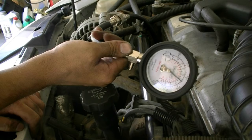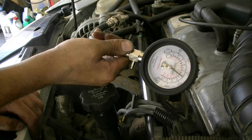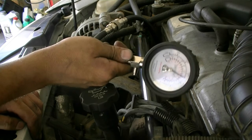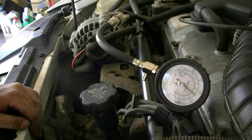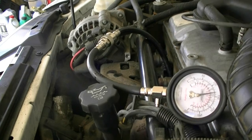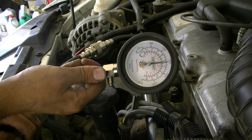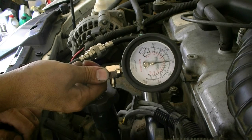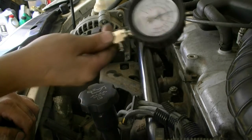As I suspected, that's a pretty substantial jump on cylinder number one. I believe the dry reading was around 120, and we got 170 plus — that's about a 40% increase. Yeah, that's huge. So we've got pretty worn piston rings or cylinder walls, at least in cylinder one. On cylinder two, also a big jump — not as big as the first, but we got 154 to 155. The dry reading was about 118 to 120, so that's roughly a 20% increase.